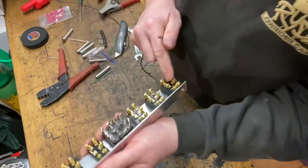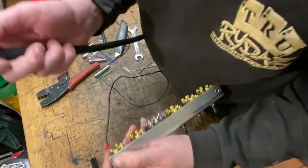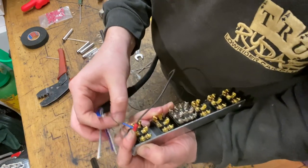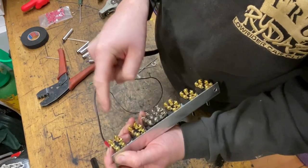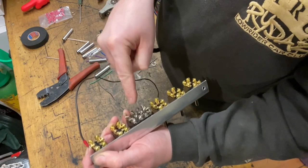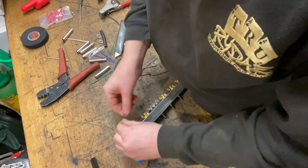And then I'm going to be wiring from this end of the switches. It doesn't matter where you wire from, as long as they're all linked in the right order. So I'm going to wire the first termination to there. So the 24 volt, if you remember, this blue wire will be going to this first terminal. And then as these are all commons, these are going to be linked. So I need to make all these little link wires to connect all of these terminals together. So I'll just film the first few.